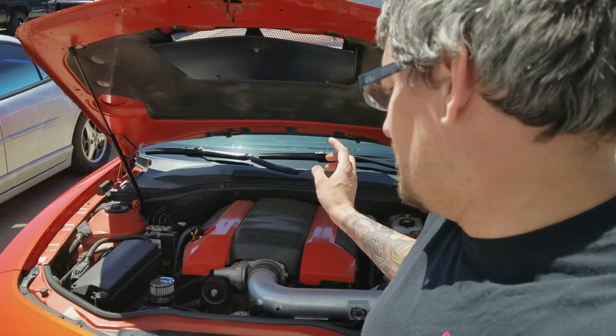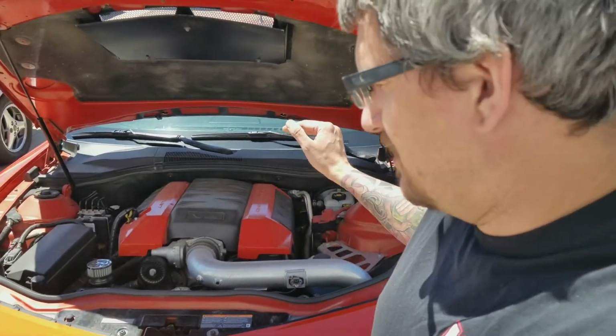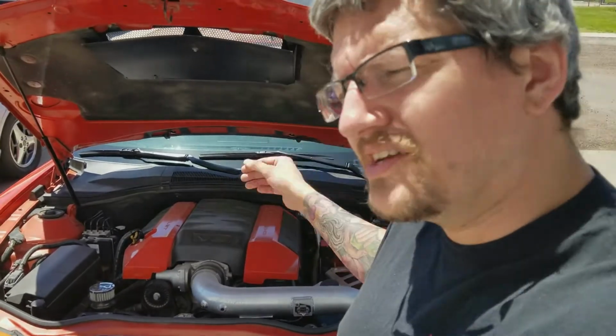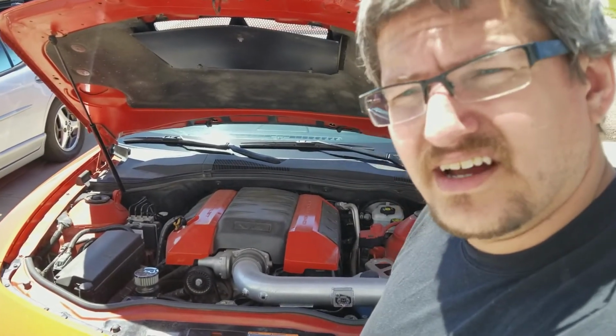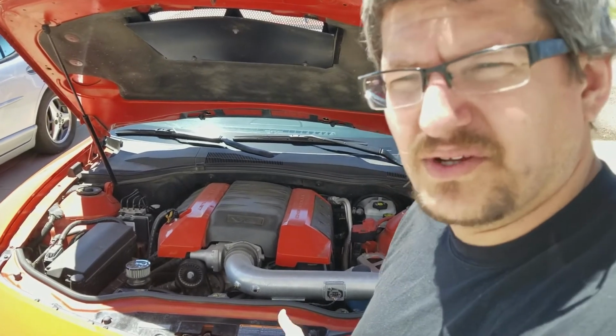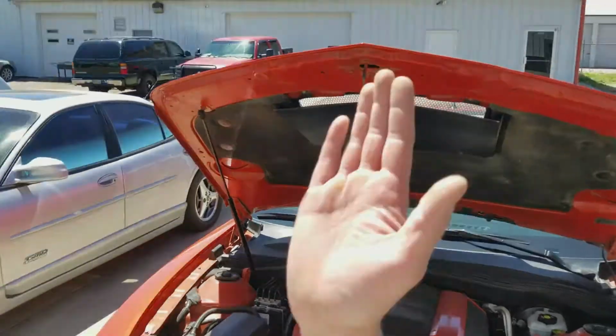We're also going to do a flex fuel setup on this, and we're going to install an AEM True Boost gauge, so that way when he's running E85 he can bump that boost up, make more power. So we'll see how much we can make on this stock clutch, because I think it's a stock clutch still. I could be wrong though. Well, I suppose let's get to work.